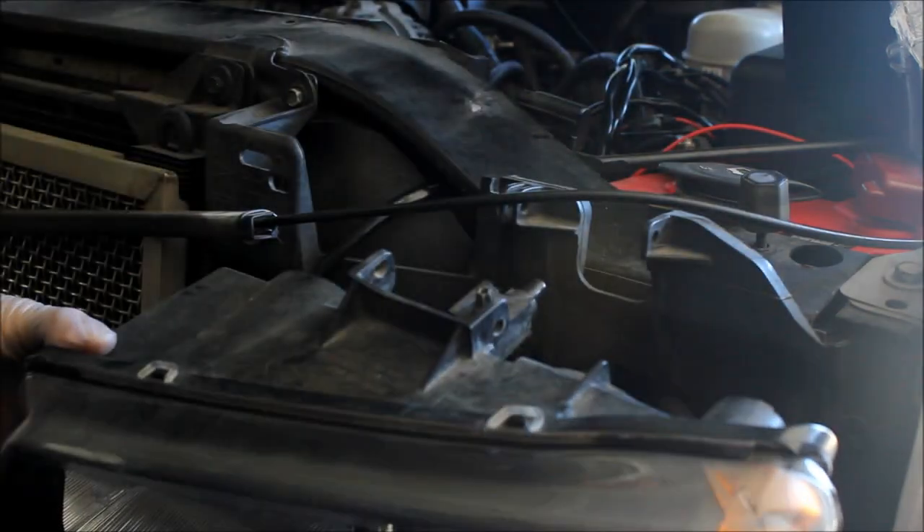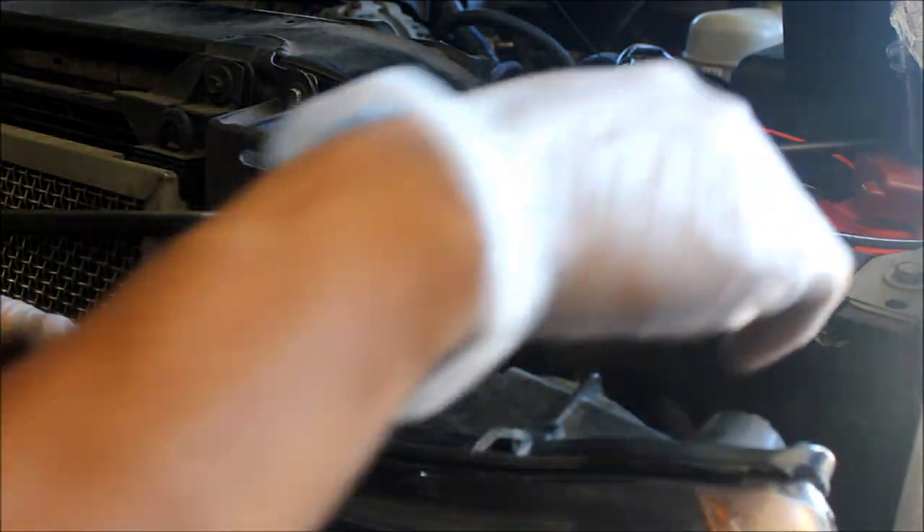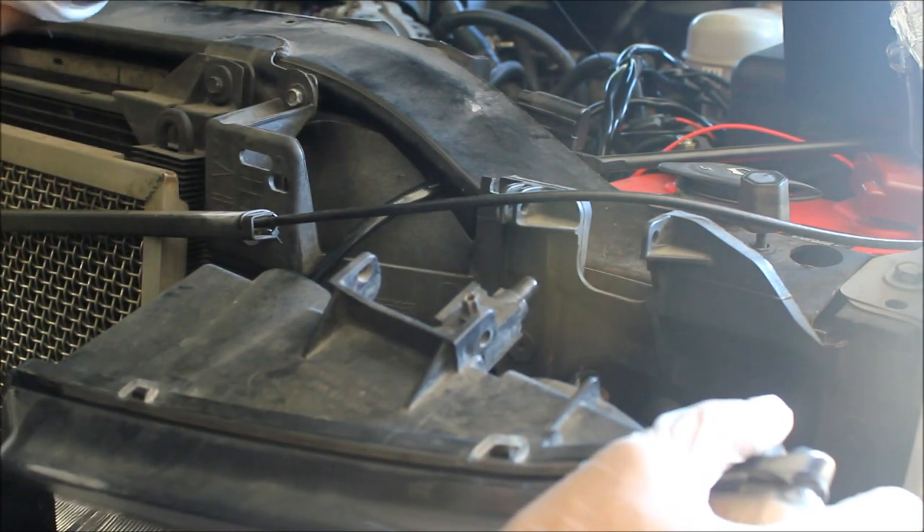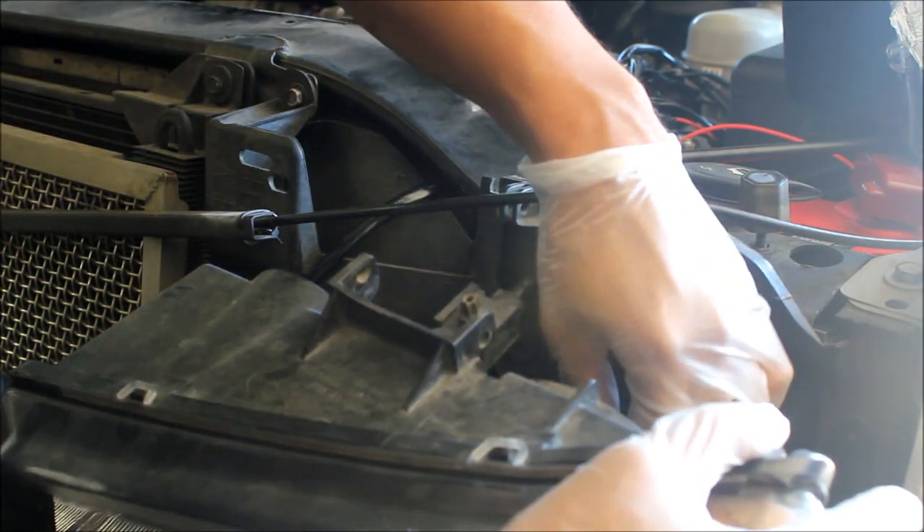Keep in mind, because we're just doing a quick switch, I need to keep this out to make it easier to get the bottom housing. So we're going to have to be careful on these bulbs. I'm wearing latex gloves to make sure I don't get any oils on the bulbs. We're going to take the bulbs out right now.